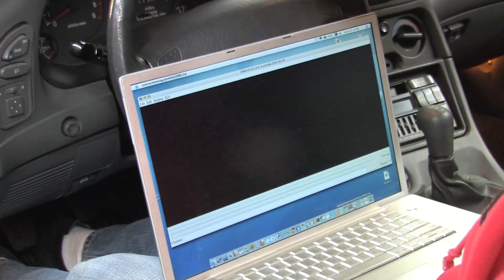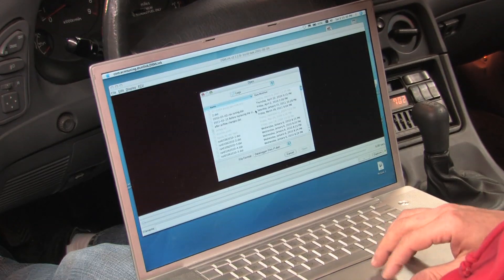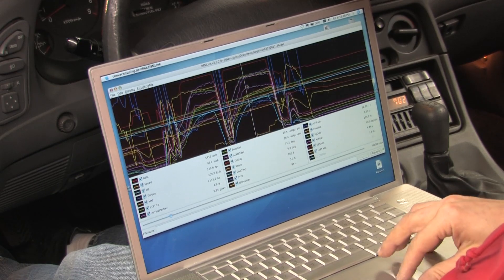I am out of fuel. I've actually been out of fuel from go, but without an intake air temperature sensor, I've managed to street tune 93 octane with an air-fuel ratio of 12.5 to 1, and rarely ever knock.